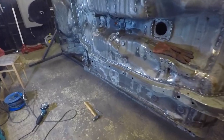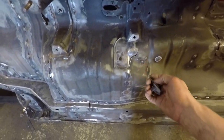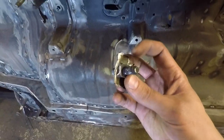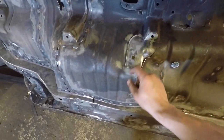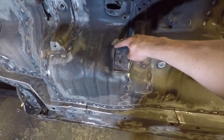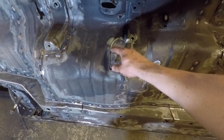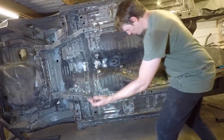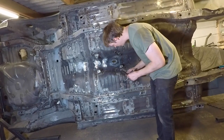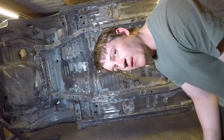Wait for that paint to dry. I'm going to look at these ones - these are the inner belt straps, this is like the standard location. The Group A cars would have just bolted straight onto that and within the regs you can actually bolt straight onto that. It had a captive nut on it and then a stud that went through that I couldn't get out. This is only 1mm and this is like 0.8mm. I think what I'm going to do is figure out the right size and cut this section out - it's just got three little spot welds in. I'll cut that section out and then replace it with a 3mm plate. Sandwiching old metal like this is just asking for a rusty nightmare in the future. 80 by 60 - 48, it's 48.